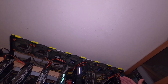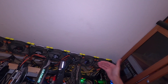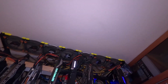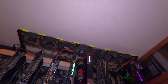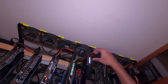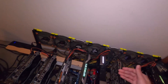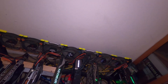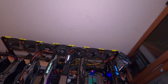The concern is: imagine if you had eight or six of these in a frame. One card at the end will be pushing its heat into the next 3080, which would then push its heat into the next 3080, and so on and so forth. The card towards the front may not be as impacted by the back fan, and there are still vents where some airflow goes out, but I can see that being a warm setup.